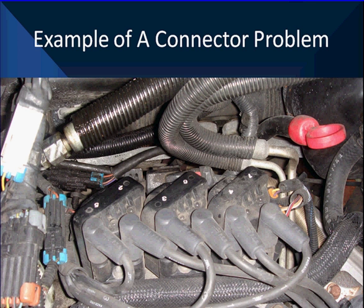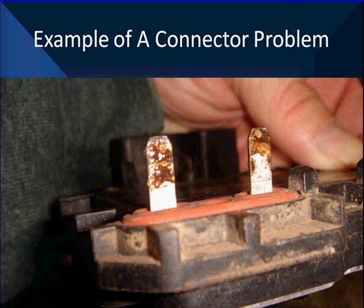Here's a problem car someone called us on — it had some misfire codes they couldn't figure out. They cleaned the injectors and did all the routine tests, swapped some coils, but the misfire wouldn't go away. We found primary current to be low — surprisingly on two coils. You can absolutely positively see why primary current was low. B-plus was good coming into the connector, but the problem was getting power to the coil itself due to corrosion. We had to replace both the coils and the base unit.